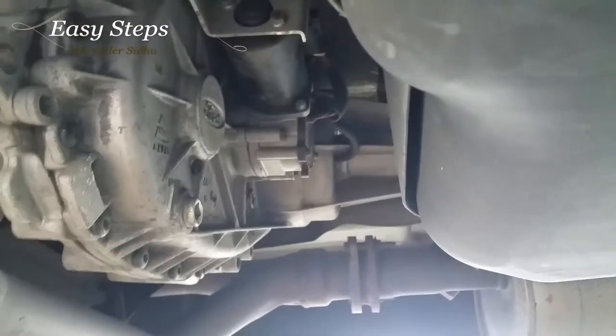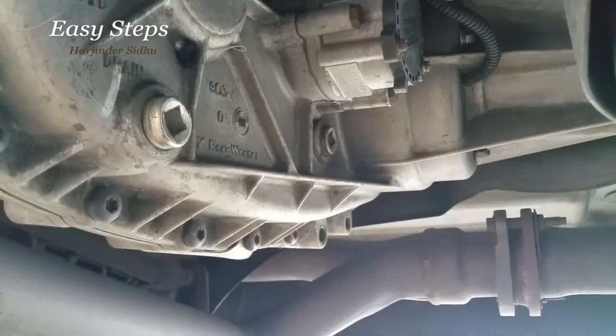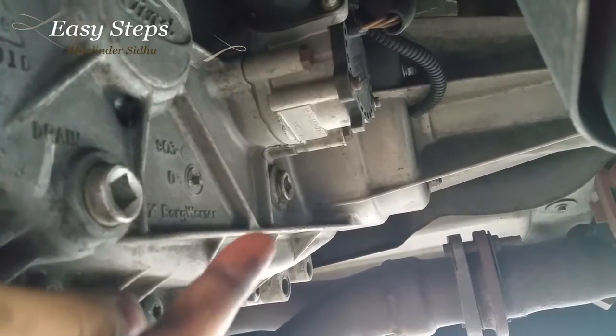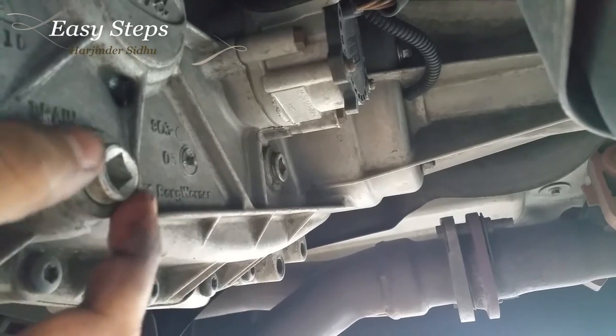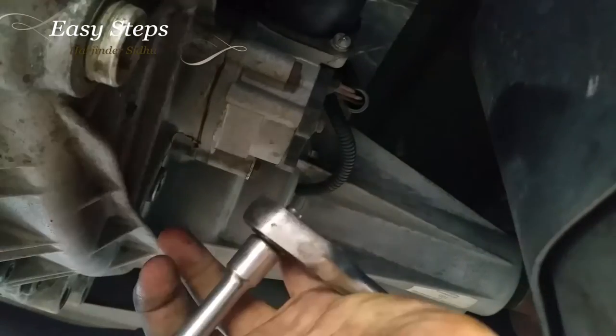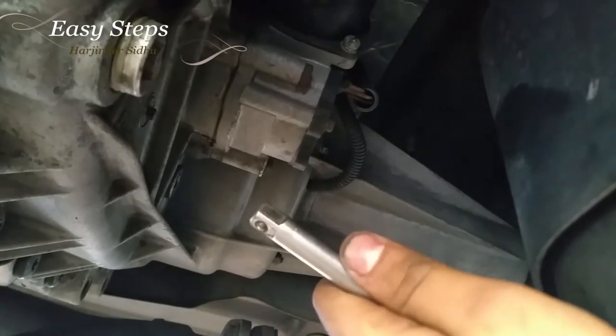Here is my transfer case. To drain this, here's the drain plug on the other side. Right over here, that's my fill plug. For opening the drain plug, I'm going to crank open the fill plug first, and then I'm going to crank this open, remove it, and let the fluid drain. The tool you're going to be needing: a socket wrench with the 3/8 drive extension.